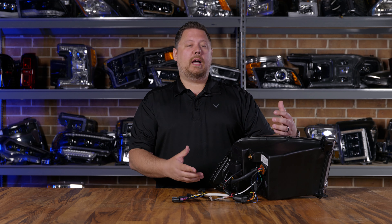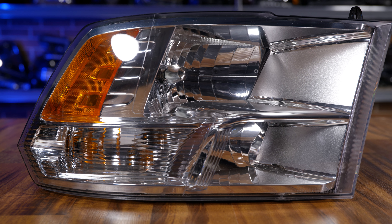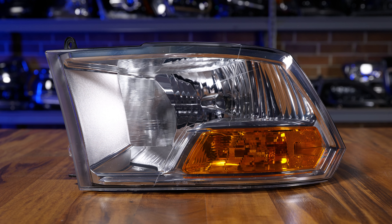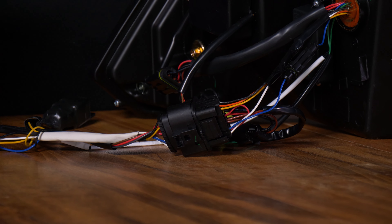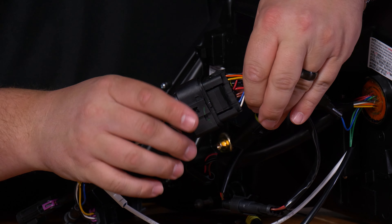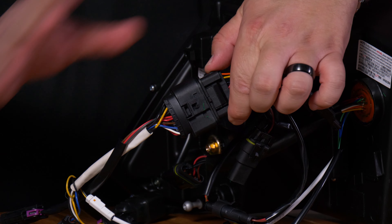On the backside you can see all the wiring and mounts. It may seem like a lot of wiring, but that's just because this thing has adapters for any headlight your truck might have come with. If you have either of the reflector halogen headlights — the quad that uses H11 and 9005 bulbs, or the dual that uses a single H13 headlight — you're going to use these wire harnesses right here for your hookup: that's your low beam, high beam, side marker, turn signals, parking light, DRL, the whole thing. But if you have the projector style headlight, this connection is what yours is going to look like — you won't need any of those extra connectors. Your factory headlight wiring plugs right into the XB LED headlight wiring, making it plug and play for the projector or either of the halogen headlights.